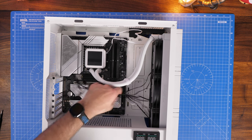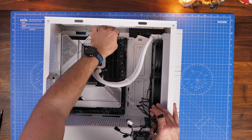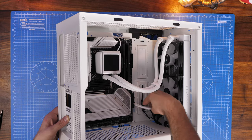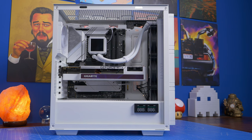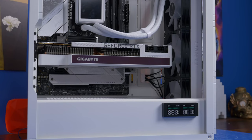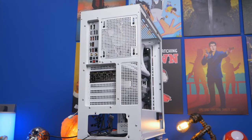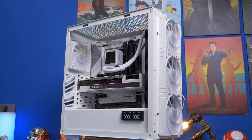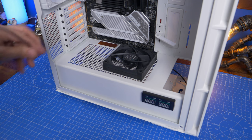Running cables for the fans through the main gap works but you could route them down through the hole below the radiator for a neater result. There's still space for a 3090 with a front-mounted radiator, which is a good sign. If you have longer 40 series graphics cards check the case specs in the description. You can also add extra case fans at the top. Additionally, two 120mm fans can be mounted on the bottom tray above the PSU shroud, facing downward to pull cold air in from below and blow it onto the graphics card.